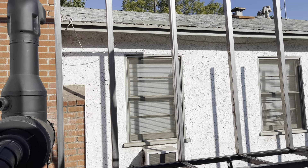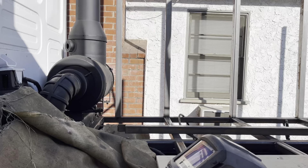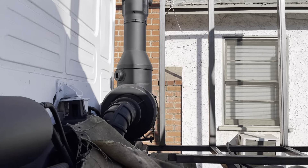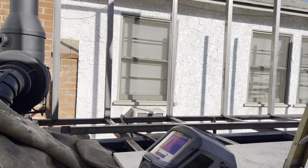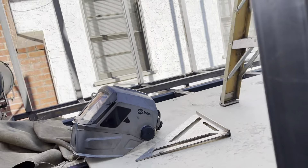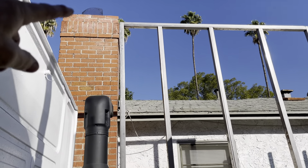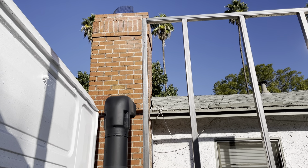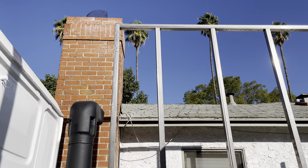As you enter the main living quarters it'll be a flat seven-foot roof, and the bed will be nested up in there. Either doing a 65 or 70-inch TV — this area is going to be a theater room below where the bed goes. I'm squaring all of these with the eight-foot right here, which puts me at 12 foot 6 inches total — one foot under legal limit — and that's not going to have anything other than solar panels on top, so that'll work out really well.